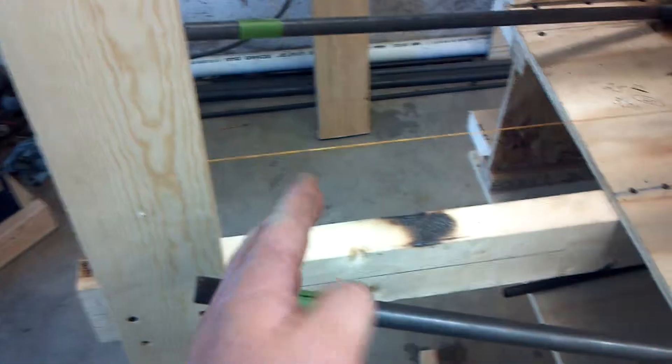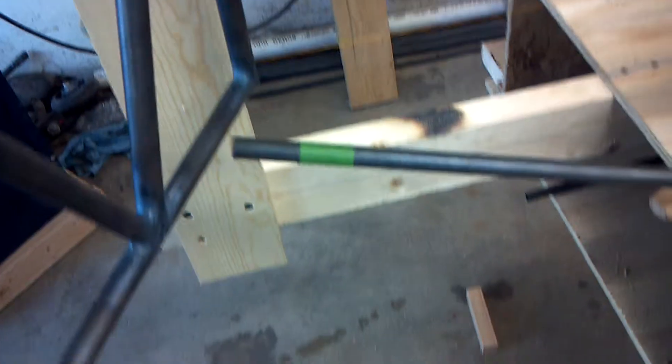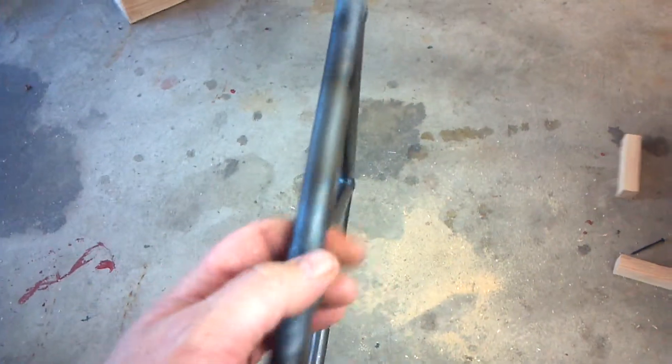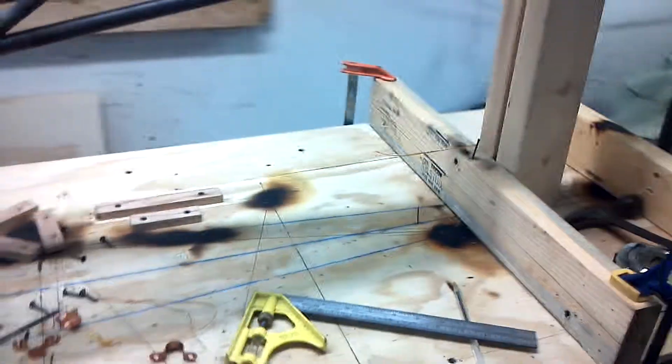All that really does for me is when I go to lay in my engine mount here, it's just going to be just below the engine mount — below this bottom tube. That way I know that when it's just a sixteenth under this tube, I have a center marked here. I'm just going to line that up, so I'm lined up on the center, lined up on the top. About four inches up off that table, all the way down — very, very important number to get.